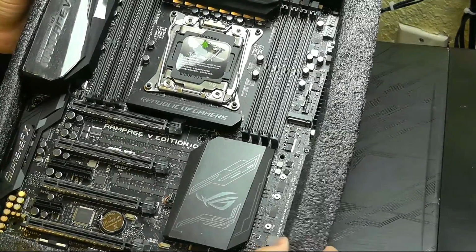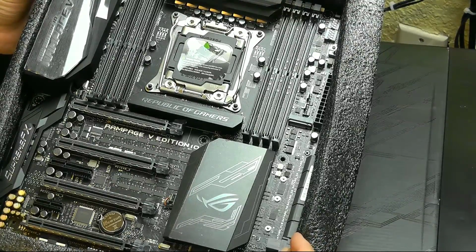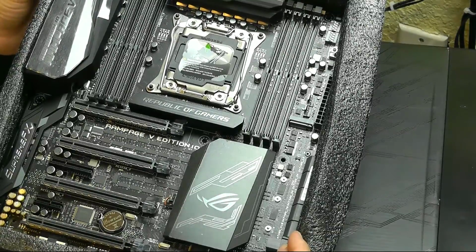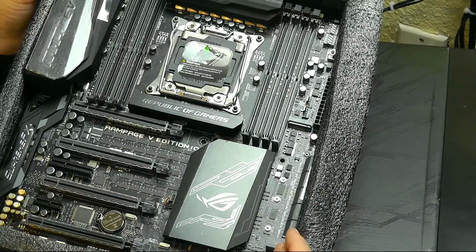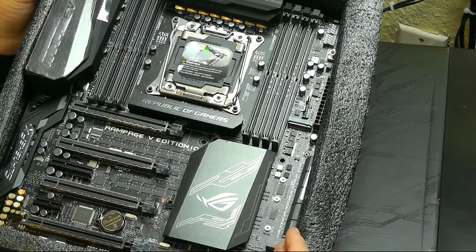You've got a little switch right here for your SLI 2, 3, and 4 ways. Keep in mind, if you're running your 1080s or 1070s, those only run in 2-way now. So they've been going back and forth on that, but it is 2-way for sure. If you're running older technology like Maxwell or whatnot, then you can do 3 and 4-way on those.